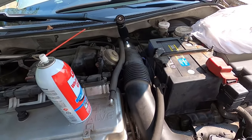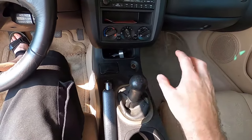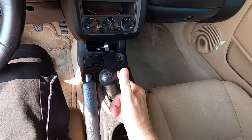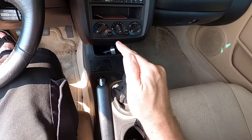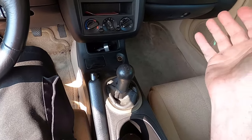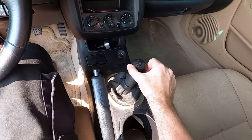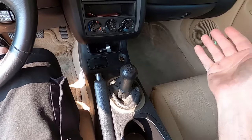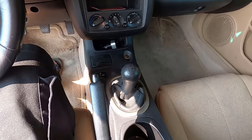I've driven it a little bit to try to move it around and get it loosened up. It's not perfect, however it is moving back and forth and side to side now. The bushing that was sticking on this one was the side-to-side movement. You can always replace the cables or even just the bushings, but for a quick, reasonably low-effort fix this seems to have done it. If you remember from just a couple minutes ago when it didn't want to move at all — pretty happy with this. Hopefully that was helpful; if so, please like, subscribe, comment, and good luck with yours.